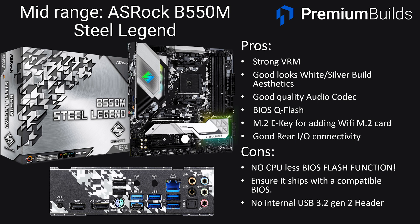Also in the mid-range there's the ASRock B550M Steel Legend. Our one misgiving with ASRock boards is that none of them appear to have an easy BIOS flash solution, so if you purchase this board make sure you've got a means to update BIOS — either with a compatible older CPU, a shop that can perform that for you, or confirm it comes with a Ryzen 5000 ready BIOS. Besides that, it's a board with a strong VRM and good looks — it's a silver highlighted board which fits nicely with silver or white themed builds. It has two M.2 slots for storage and an additional M.2 e-key slot specifically for adding a Wi-Fi card. At $140 it makes a good purchase.